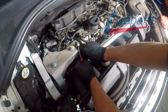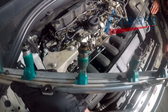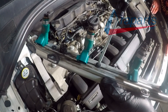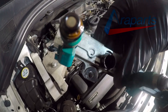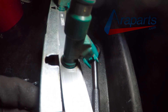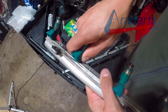As I pull the fuel rail off, you'll notice I spill some fuel, so have a fire extinguisher on hand just in case. You can clear the fuel rail by turning off the fuel pump — typically by pulling the fuel pump power fuse and cranking the vehicle over to empty the fuel rail. Once the rail is off, there are four Torx bolts that have to come off to remove the fuel injectors. Once you get those Torx bolts off, you can slide out the locking part of the fuel rail and remove the injectors. There's also an O-ring, so wiggle the injector out carefully.